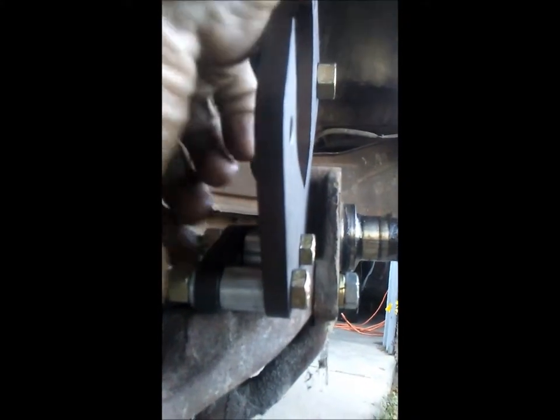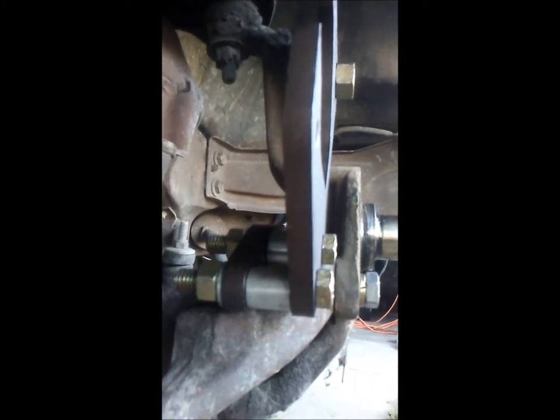See those spacers — those are the smaller spacers and bigger spacers. This one here had the smaller spacer. So you've got your bolt going through here with a spacer, and your bolt on the end. On this side you've got the longer spacers — two bolts through here, two spacers, two lock washers, and nuts. Now we're ready to put the calipers on.